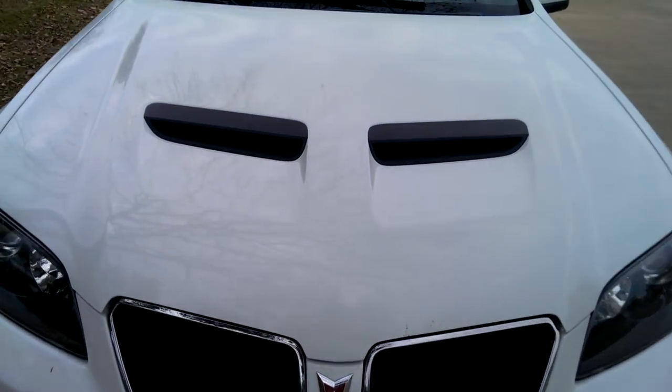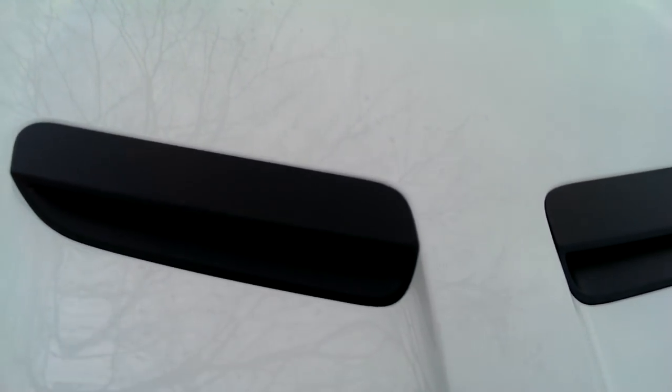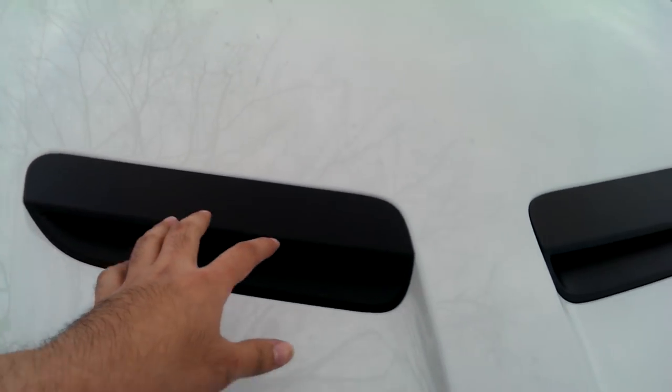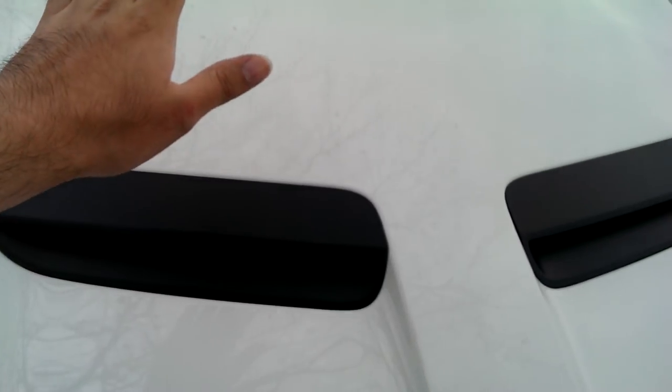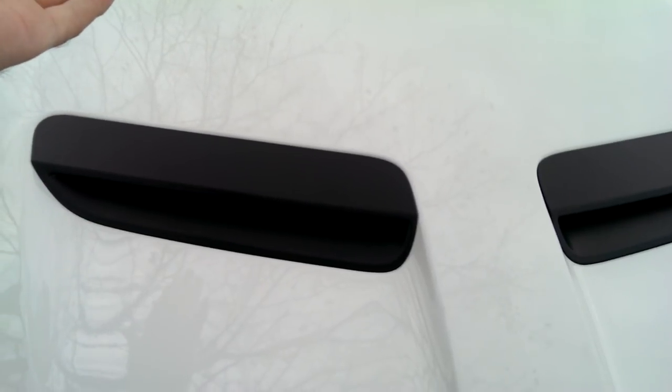I did the hood scoops, which were very difficult to remove. There's some pins underneath that you have to jiggle with — there's two of them holding it in place — and then it just kind of pops up and then slides forward. But if you have your hood tilted up, it'll slide down the hood and those pins could scratch your paint.